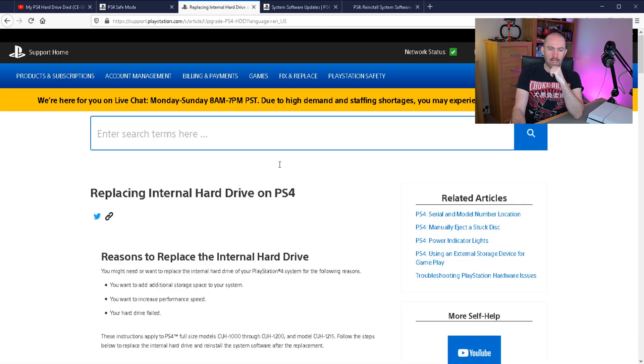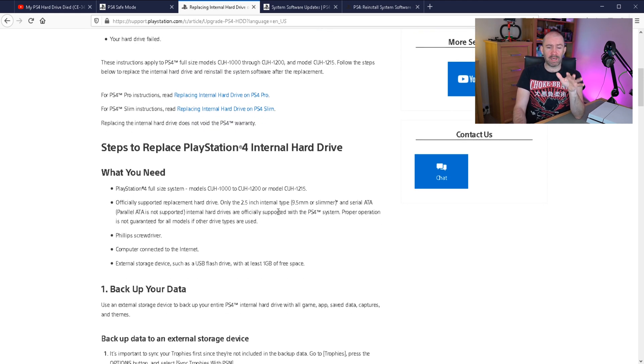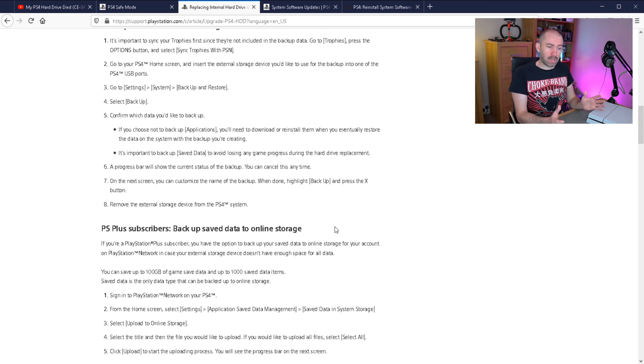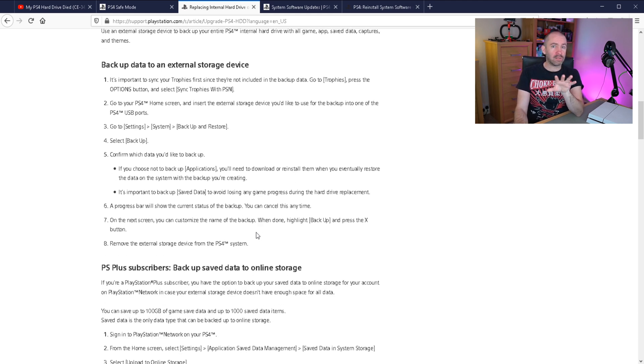For some of you, you will have to do an upgrade, and this is the guide. I'll link to all the relevant pages in the description. The first step here is to back up your data — back up all the information on your hard drive, all your games and save data, to an external storage device and online storage. I can't do that myself because I don't have the original drive; it wasn't working so I lost everything. But I do encourage you to do this if you're simply replacing a drive that is still working, whether upgrading to an SSD or a larger mechanical hard drive.